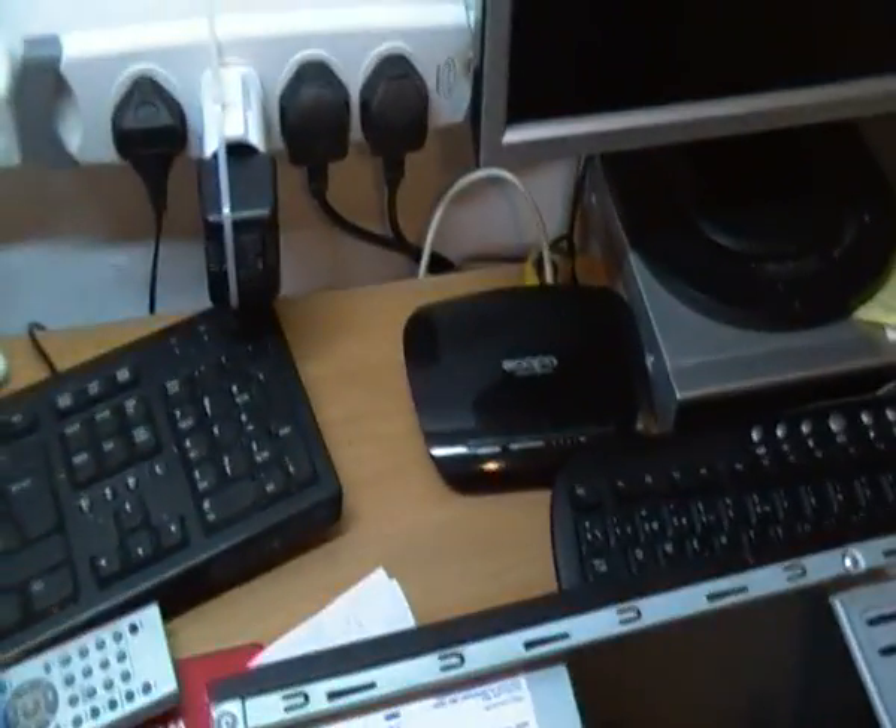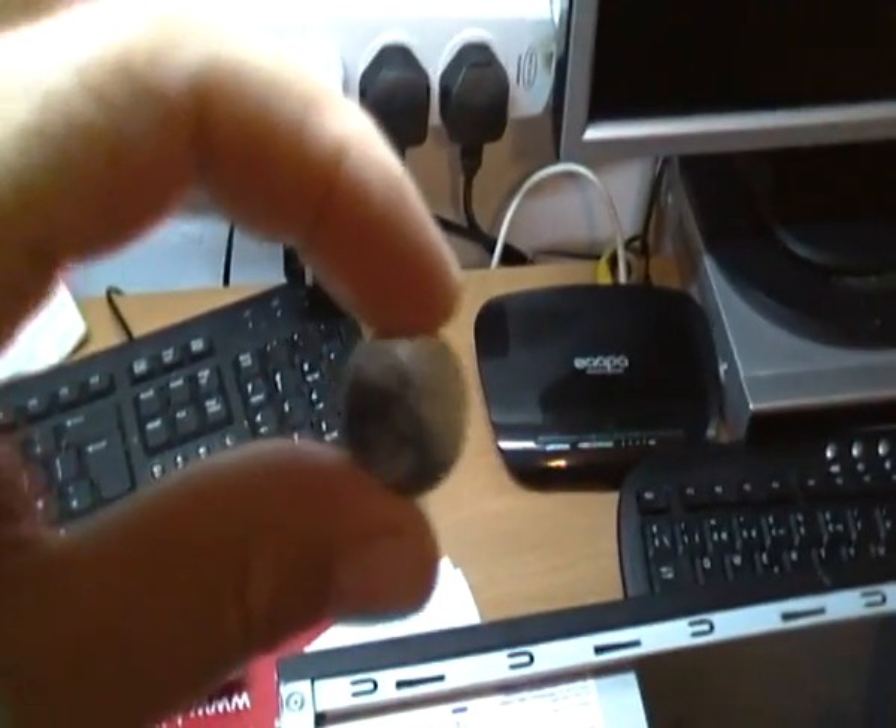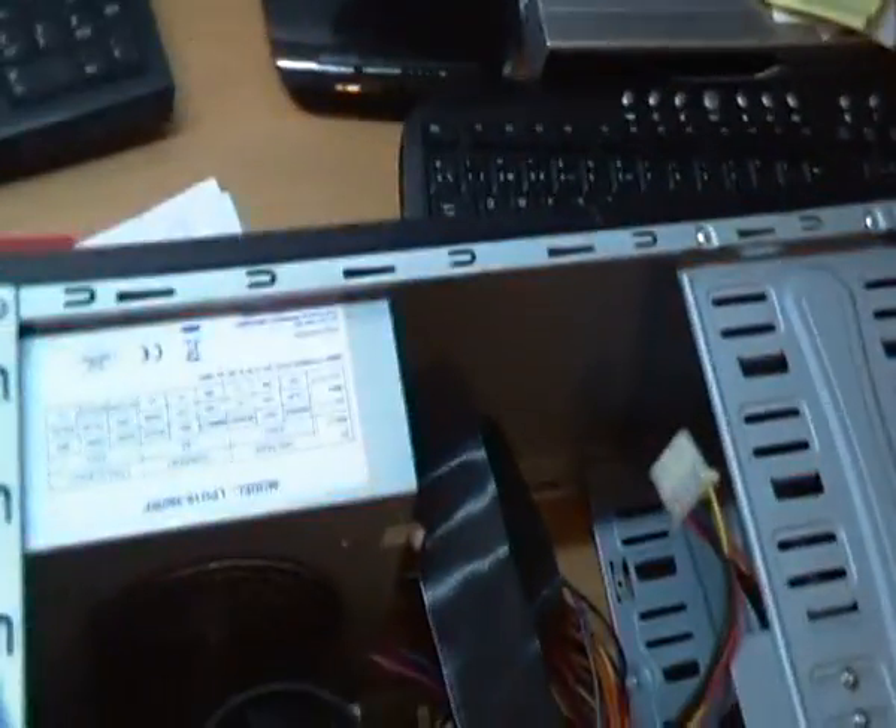When you put it back, just make sure the writing's on the top. It's a little 3-volt battery, actually numbered CR2032 in most computers. There's a packet I bought from Lidl's or Aldi's for one euro for a whole lot, so like 20 cents a battery.